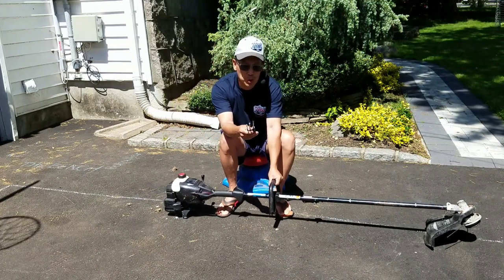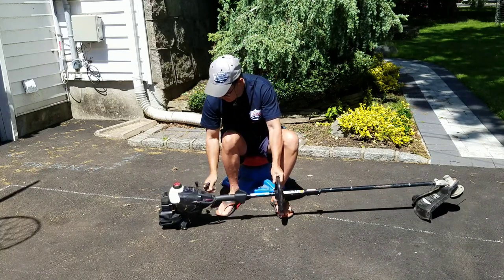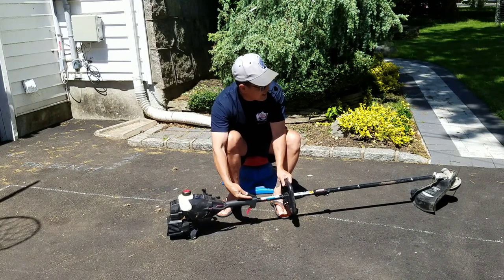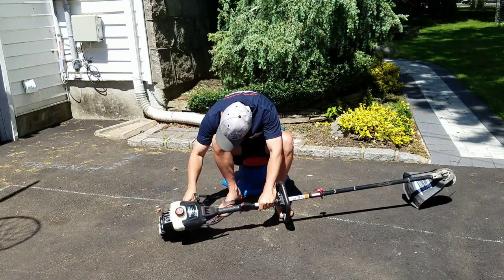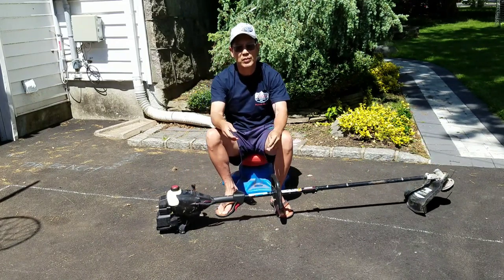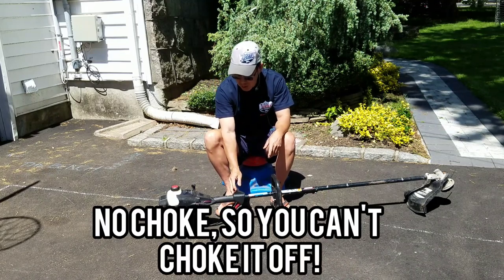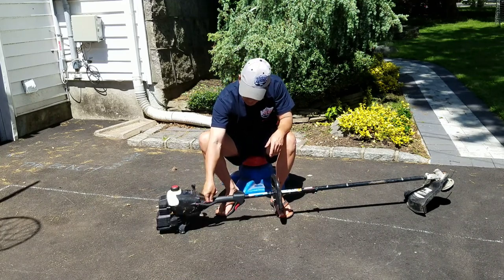I adjusted the high-low screws with my adjustment tools for the air and fuel mixture, but then I couldn't turn it off. The kill switch is broken. Doesn't work. So now I know why the spark plug wire was off the spark plug: the prior owner used it to turn it off, because it won't turn off since the kill switch is busted. So I'm gonna take this thing apart and see why this kill switch is busted,